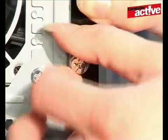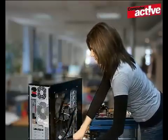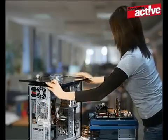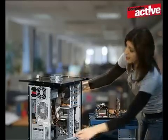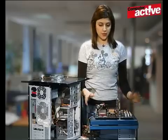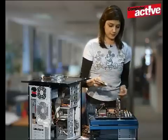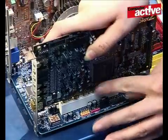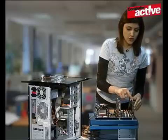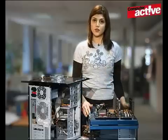Take the screws off and make sure you keep those for later. The PCI slot is found just under here, this white one here. For the purpose of this video, we will be using this motherboard to show you exactly how to do it. Grab your sound card and place it firmly into a spare PCI slot. Screw it in to ensure it stays there. Place the lid back on the case and then turn on your PC.